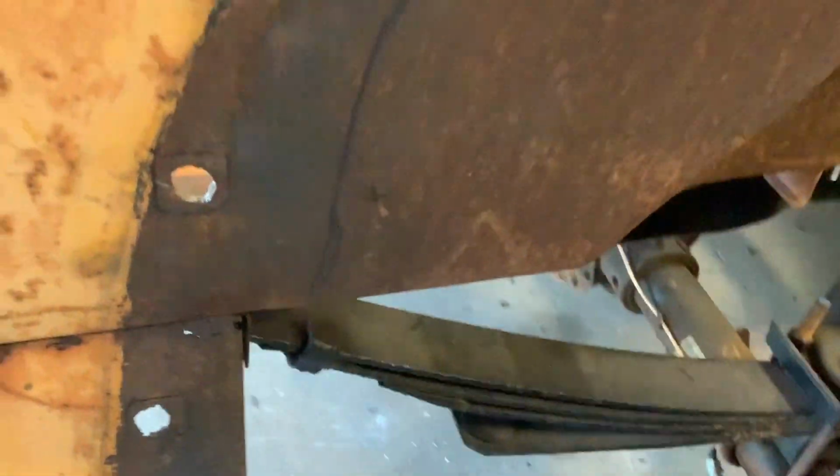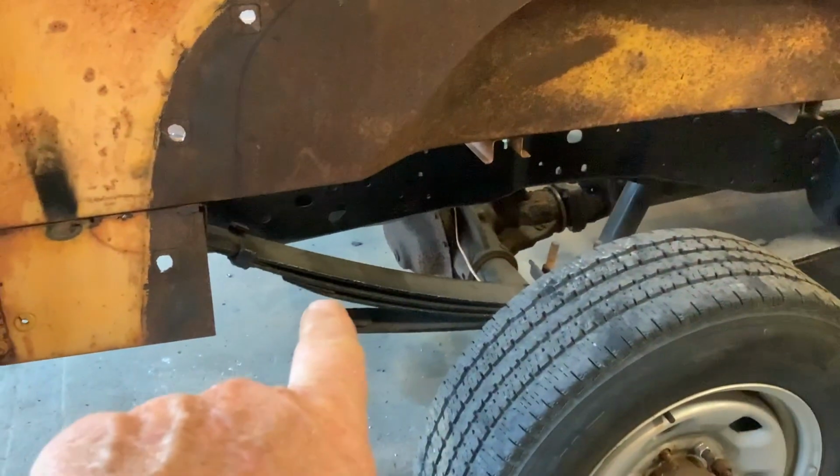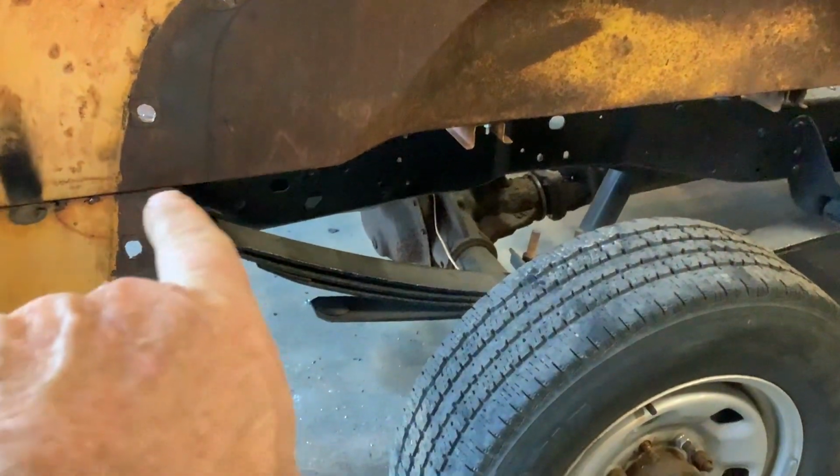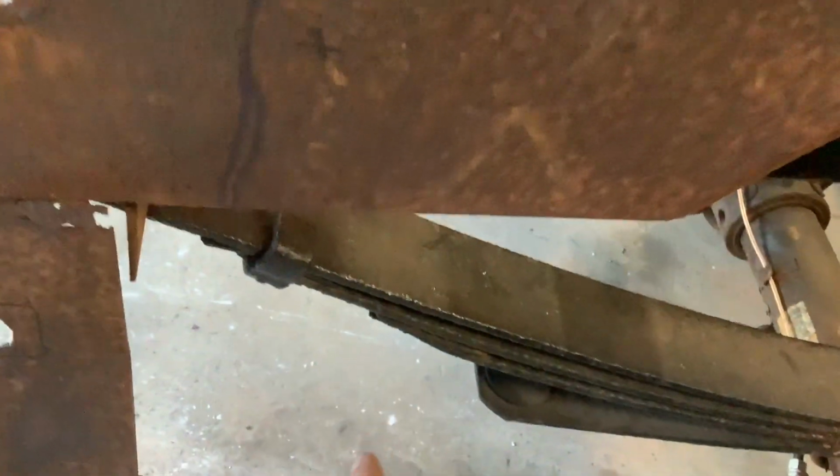it's about 1.5 inches too short. So I'm gonna have to fabricate, I'll bend a piece of metal and add the extension on to get us over into here. And then I'll butt it up, and then I'll straighten this up, and eventually I'll put some bracing in. Now on the back,